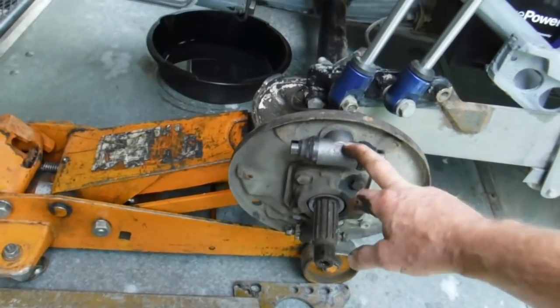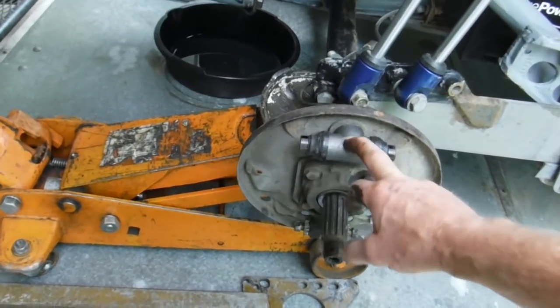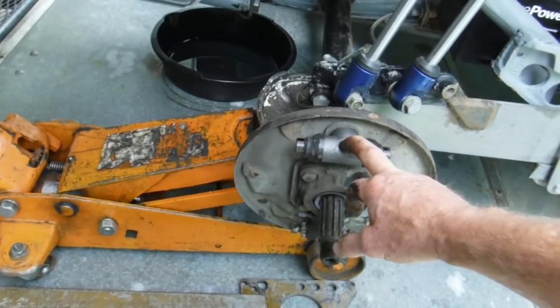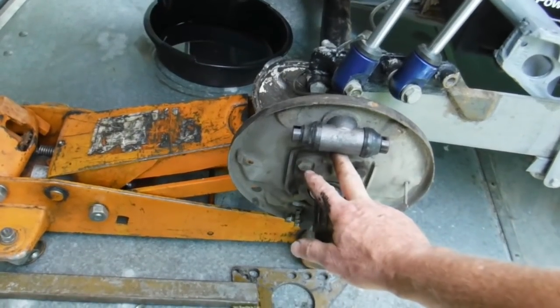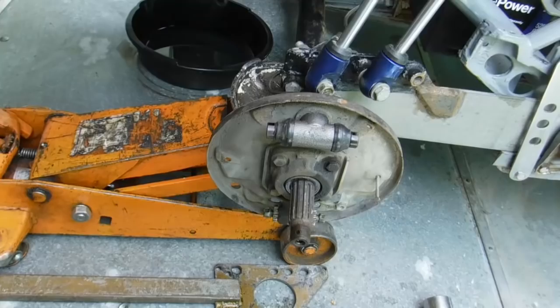There's a little trick: you can take a front wheel cylinder from a similar year and put it on the back. If you're working with a ball joint type car, you may have to file a little bit on the bolt hole. I don't recommend doing this on the street — just for liability reasons. Don't do this on a street car daily driver. But for an off-road toy where you're out in the dirt and nobody's around you, you're not in traffic — because if you were to get in an accident and somebody got hurt and they found out you messed with your brakes, you would be liable.